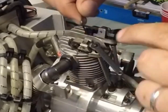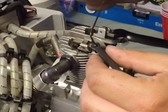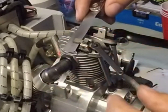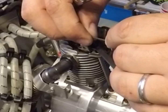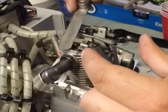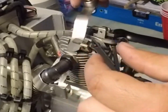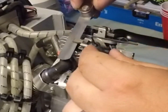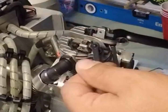I like to get the nuts a little bit snug so that this kind of stays where you leave it instead of it flopping around. Whenever you tighten down the nut, it pulls that adjuster up just a hair. So we're going to back it off just a hair. Here we go — tighten it. There we go. That one is adjusted — that's number one. Next will be number three.